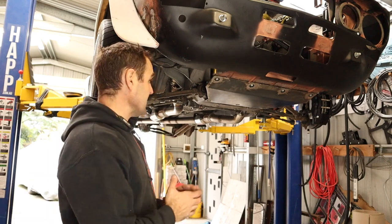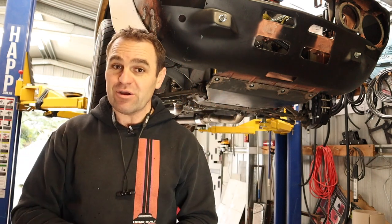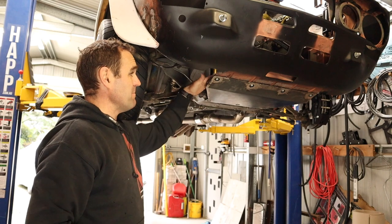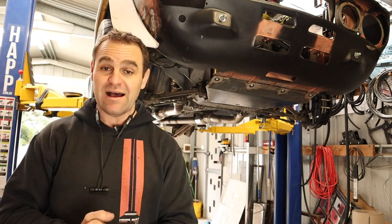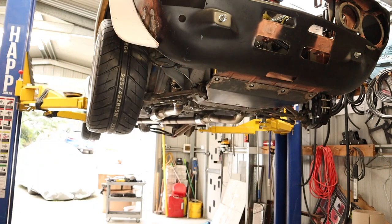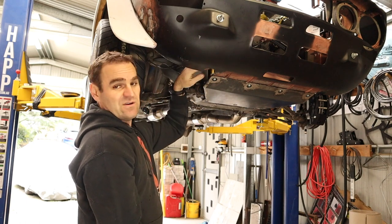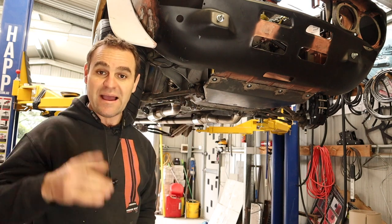Another thing a lot of people were asking was: do I need to put holes in it to cool the sump of the Ferrari? No, you don't. The Ferrari 360 standard had a flat bottom underneath it — like most modern supercars these days for aerodynamics — a completely sealed flat bottom with no flow over the sump. It doesn't really have a sump anyway; it's a dry sump engine. That's why I built my external dry sump tank with the oil cooler. And yes, the sway bar still fits — it's mounted up and sits above this plate, so no problems there.